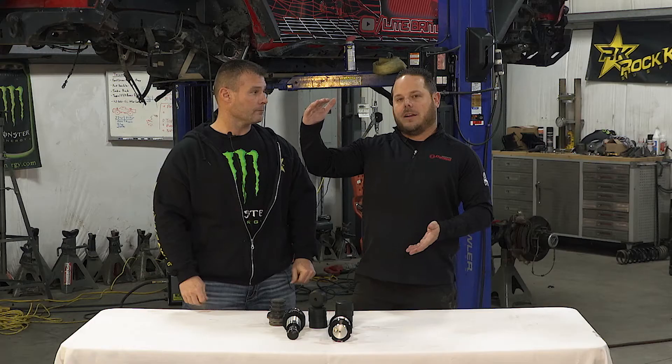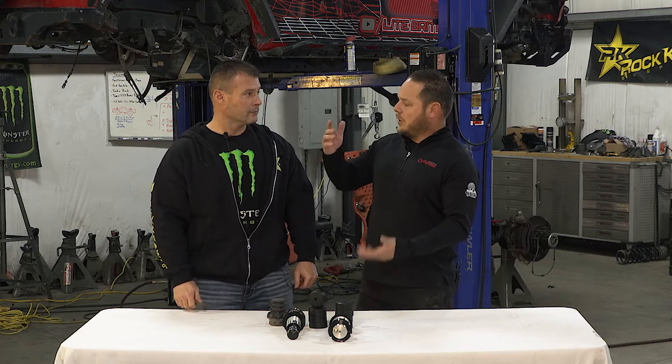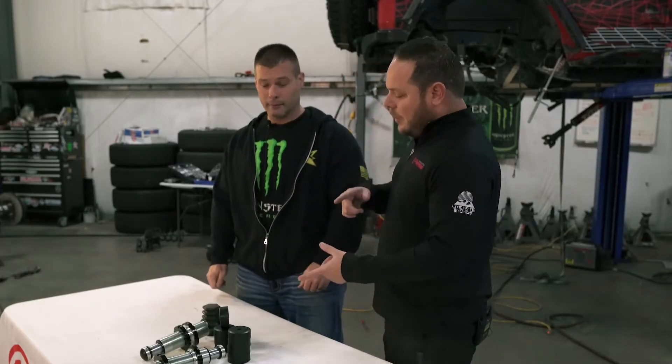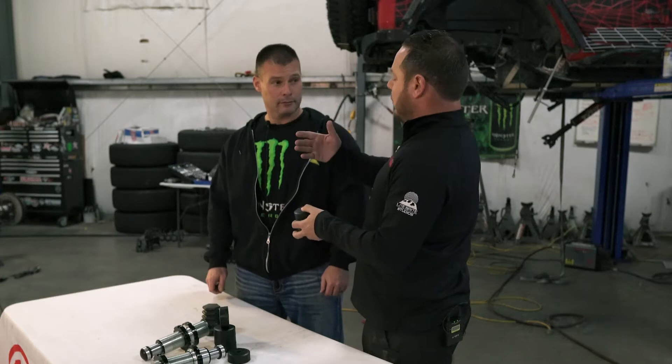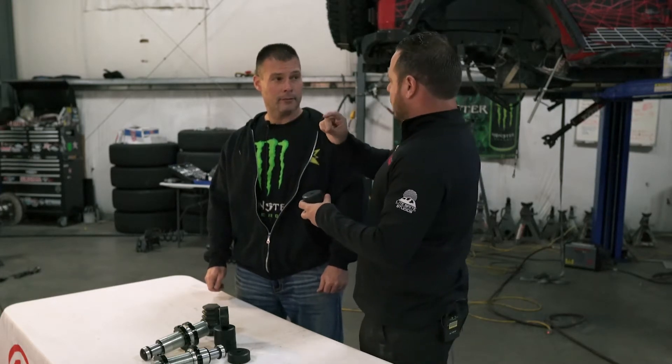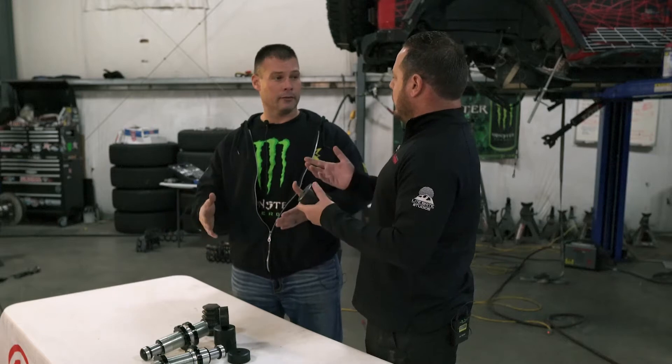If you've gone with a longer shock, it'll bottom out sooner. Some people use a smaller tire size but a long shock for down travel, but the problem is you don't want to run that shock all the way up and bottom it out. We cover what not to do in the advanced course. You keep stacking pucks until your tire would hit or until you have the shock right before full bottom out. In other instances, you're trying to prevent a control arm from contacting something or any other mechanical interference that can cause premature damage — bump stops are critical. It's all about clearance.